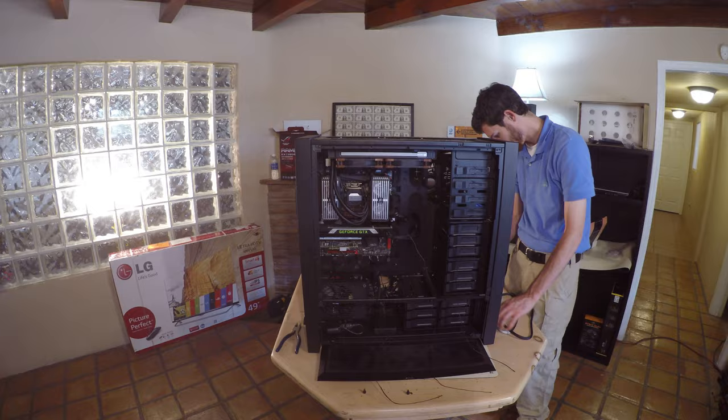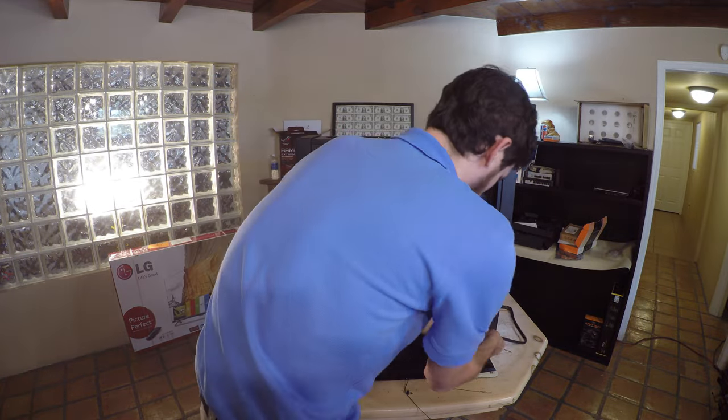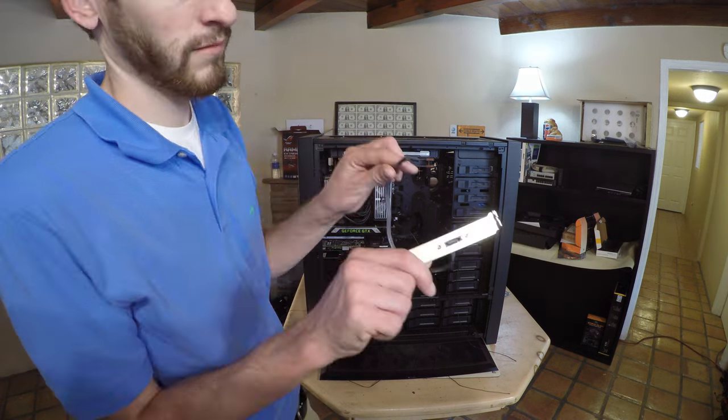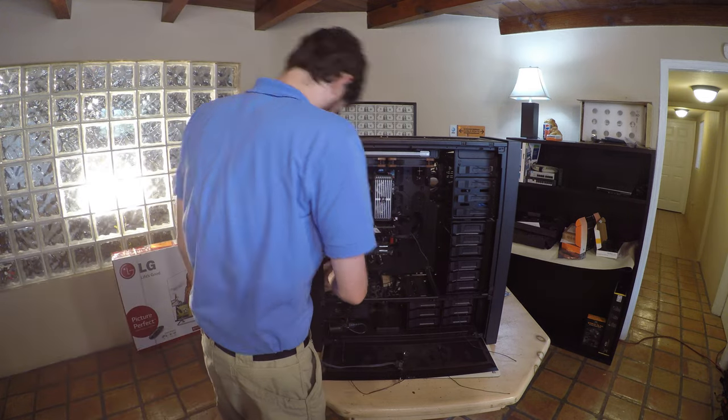Connect the SAS connector of the LSI cabling to the serial ATA drives. Bring the breakout cables through the back and connect it to the RAID card. In this case, we are also installing an eSATA backplane connector. Connect that as well right now.